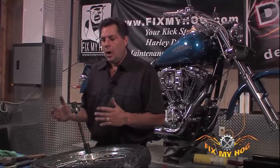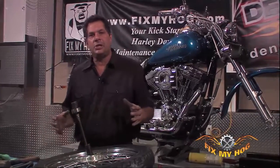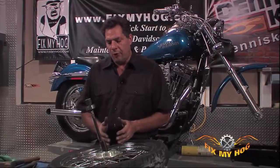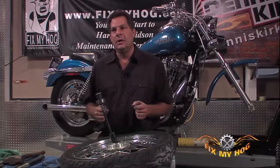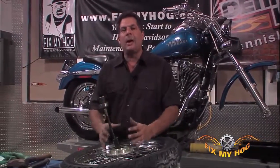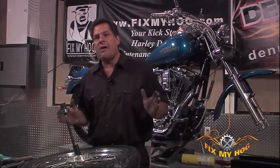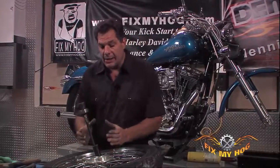That is true. You're not so much looking for expansion and contraction capabilities of a typical metal. What you're looking for is to overcome the galvanic corrosion that's created between the two dissimilar metals, aluminum and hardened steel. By heating it up, allowing both metals to expand at their normal expansion rate, and then cooling momentarily as you install the remover tool, it allows the aluminum and the hardened steel to move away from each other just enough to release that bond that the galvanic corrosion or the rust has created.